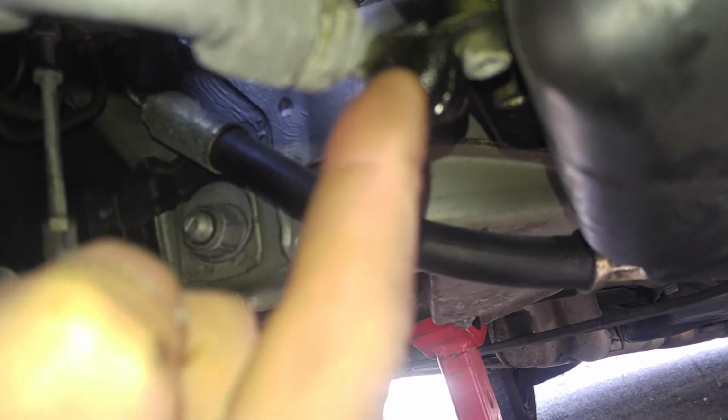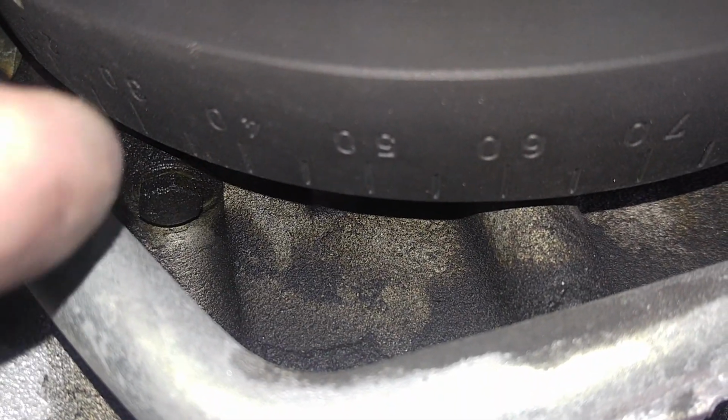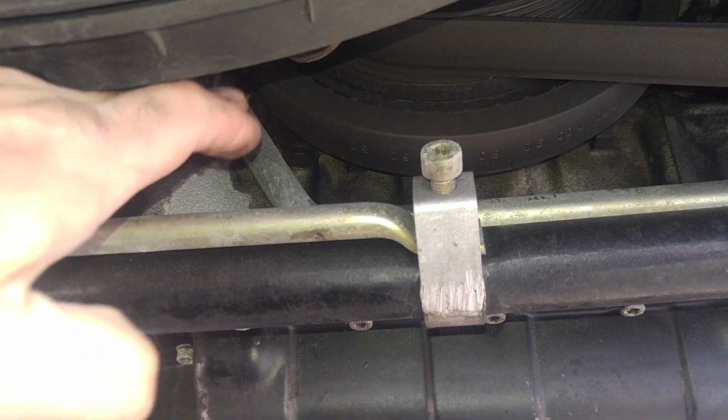We have the common oil leak coming from the timing chain covers on top there. You can see a little bit of oil. I would leave it alone for the time being because it's a very labor-intensive job and it's not critical yet. It's already hardened a little bit, so not too much. It's not a constant leak, it's not gushing out yet. You see where it's coming from, around that area. As you see from the front, it's from above, so it's not coming from the oil pan or anything like that.